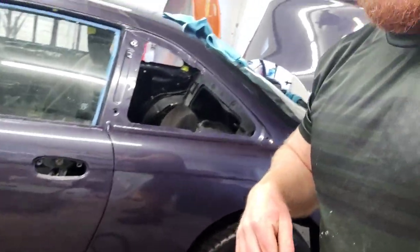Long story short, a lot of you guys are thinking, oh man, it's done — I got to repaint the whole panel or the whole side of the car. Not always the case. I'm going to attempt a blow-in spot repair on this. We're going to blow in just a tiny, tiny bit of base, tiny bit of clear, try and burn it in, blend it in and see what we can do. Otherwise we are going to be repainting the entire quarter panel.